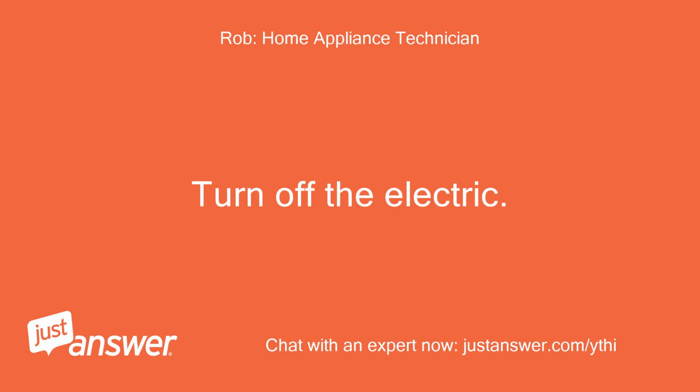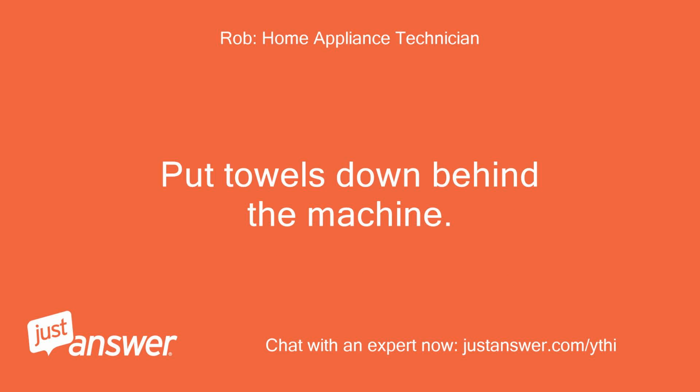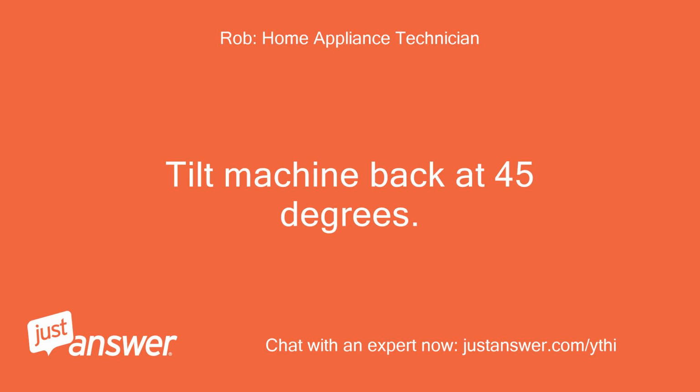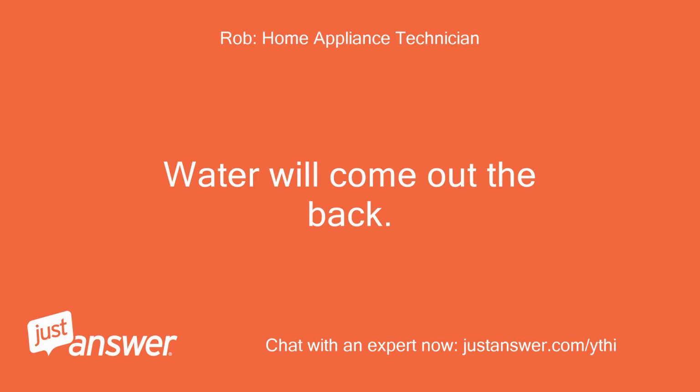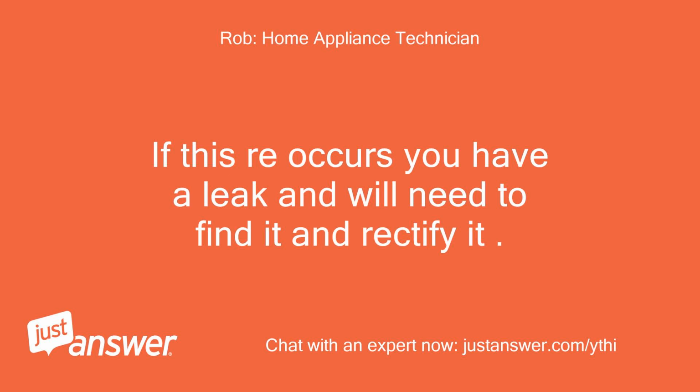Turn off the electric. Pull machine forward. Put towels down behind the machine. Tilt machine back at 45 degrees. Water will come out the back. The machine should now be reset. If this reoccurs, you have a leak and will need to find it and rectify it.